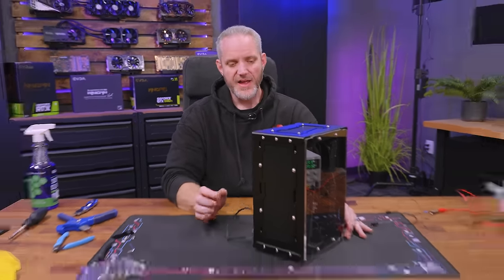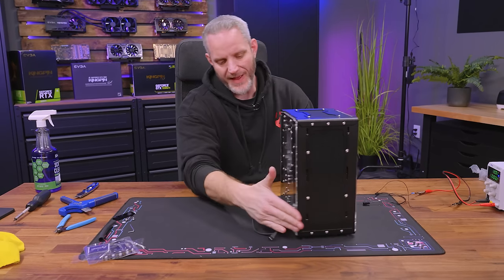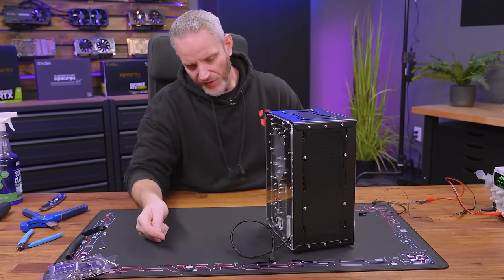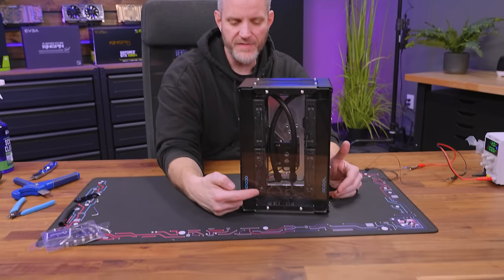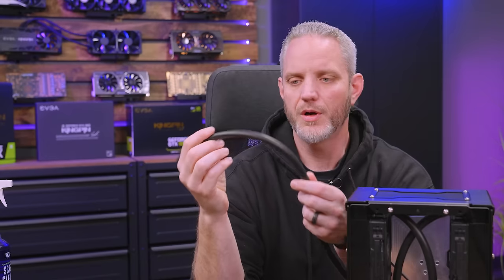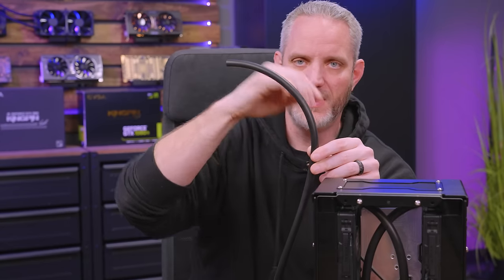So the way the loop order goes: the pump always leaves the water box — you have no choice. It goes pump down and out, so I'll have tubing with a quick disconnect there, go through the system, back in through here. This is going to need a fitting on both sides, then into a 45-degree fitting so there's not too tight of a bend. This is thin-wall tubing — it's XSPC black rubber, which I like because it doesn't leach plasticizer like clear tubing does, but it kinks pretty easily so you don't want tight bends without a coil.